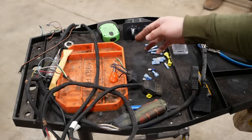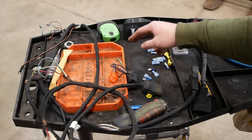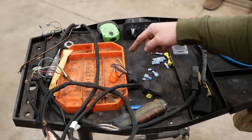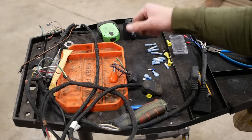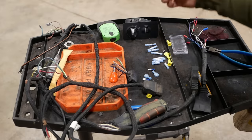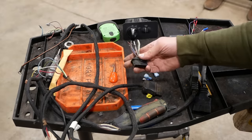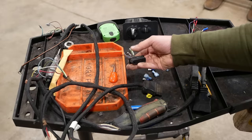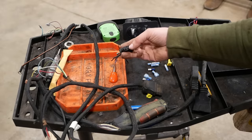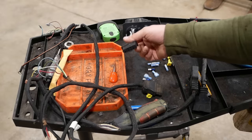He gave me the famous last words: 'do whatever you got to do to get it working.' One of his other trucks had the transmission go out, so they're down a truck and he wants to put the plates on this truck and use it for the big storm coming tonight. There's the connector that I think was on the truck originally. The brown wire is corroded all the way down to the backside of the crimp - I cannot save it. I cut all the rubber off of it, but there's no way to save that connector.